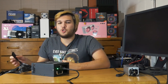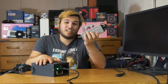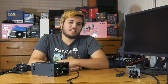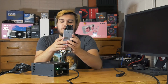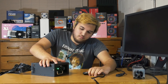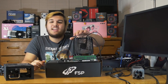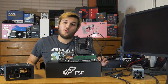I can actually just unplug it and take it out, and the unit remains on. This is fine with just a tester, but this isn't actually drawing any real wattage. I want to see if FSP's claim holds — that each one of these 500-watt PSUs can handle the entire load. I'm going to build up a quick test rig that should draw around 300–500 watts under full load to see if this one relatively small unit can handle the full load of a system.